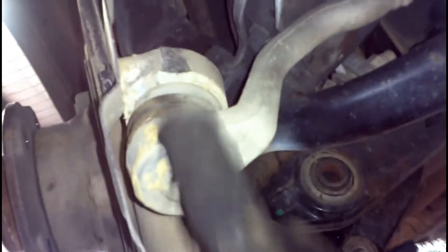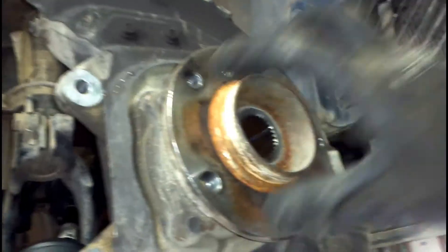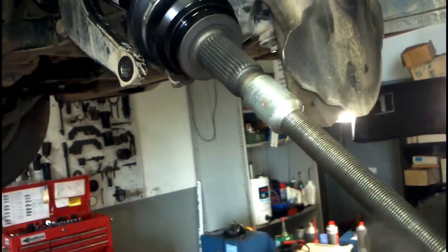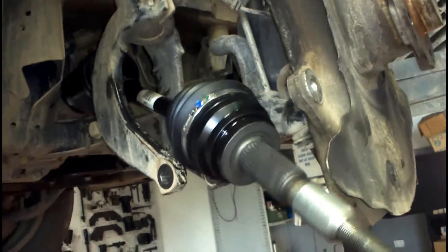I'll put all these control arms back together and all these ball joints back into the steering knuckle. I've actually taken off the tie rod end. There's another special tool that you'll need for this to pull it in. I'm going to clean the threads up — this is the pulling-in tool. That'll screw onto the end of this shaft, just like that. As soon as you have it in the internal spline in the bearing, you pull it through from the outside in using this.